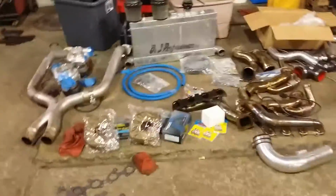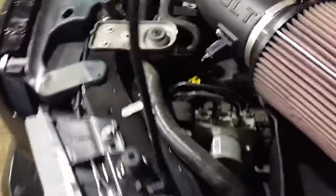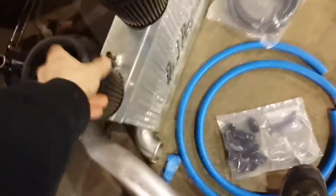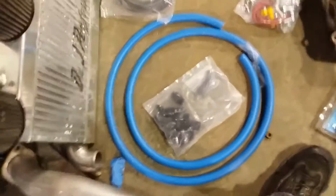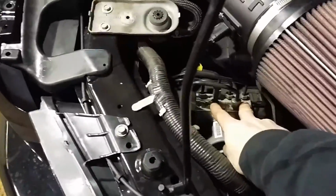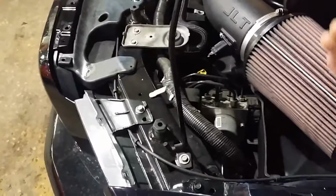Now, everybody praised me on the last video. I showed some of the Fox twin kit, intercooler brackets, other little things that I sell and make for these kits. This car will serve perfectly for me making the ABS drop-down bracket. As you can see, the lines sit very high on these, and they smash into the air filters. As you can see right here in this one, they smash into the air filters. The ABS drop-down bracket corrects that. The K&N filters work great. Bending the lines a little bit helps some, but the ABS drop-down bracket brings it down further. Of course, you've got the 2 braided hoses that come in here. So once you maneuver the ABS unit out of the way, it's a lot easier to fit this driver's side air filter.